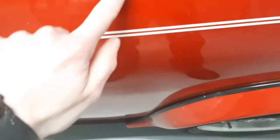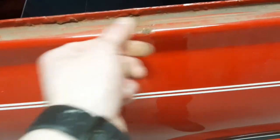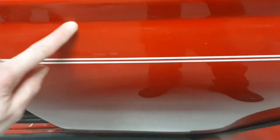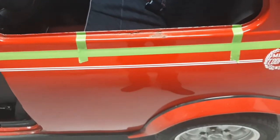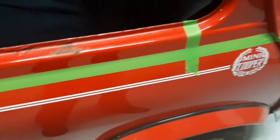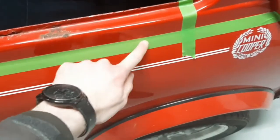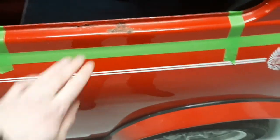Next, choose how far your repair is going to be — it could be down here, or it could be smaller like mine. I'm going to run a strip of masking tape all along here to set my boundaries. Anywhere inside the masking tape is where I'm happy to have sanding scratches or paint; anywhere outside I will definitely not sand. A few cents worth of masking tape really helps and guarantees you won't sand anywhere you don't want to.